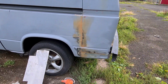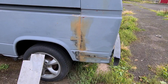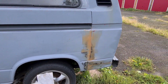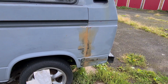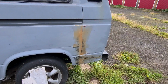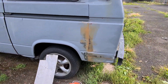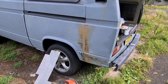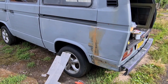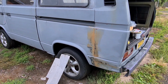So, let's just start with a bit of fiberglass, getting those seams. The reason we went into the seams is because it was all filled on the opposite side and I wasn't going to dig them all out. Have you heard me mention loads of times that I quite like it when it's all looking smooth down the one side, no seams? It's probably not for everyone, it's not original. So yeah, carry on with that, wait till that dries, knock that off, and then maybe put a little bit more on, then start the filler.